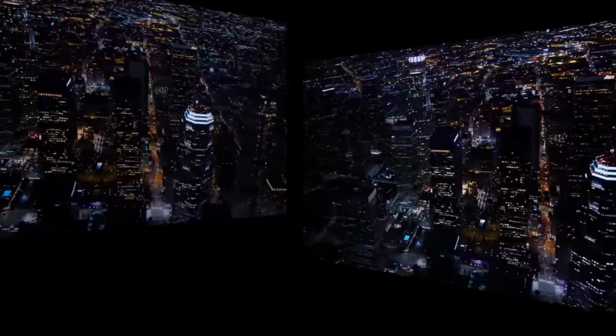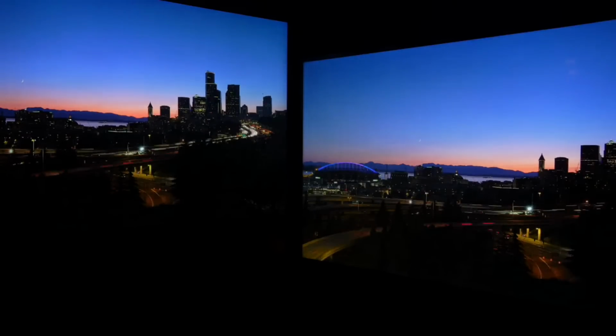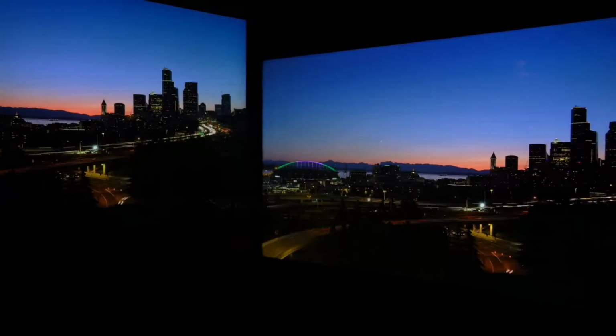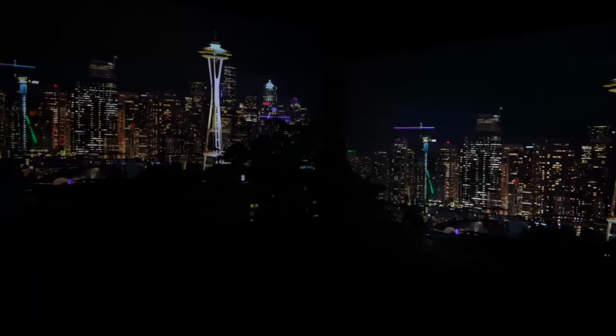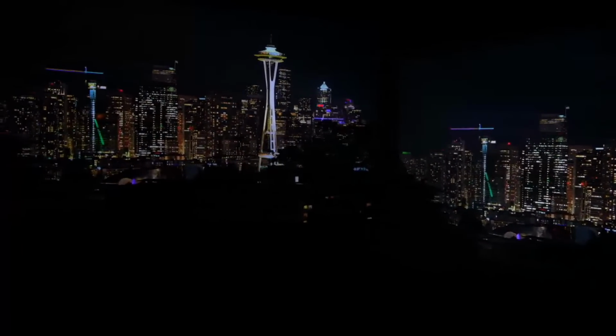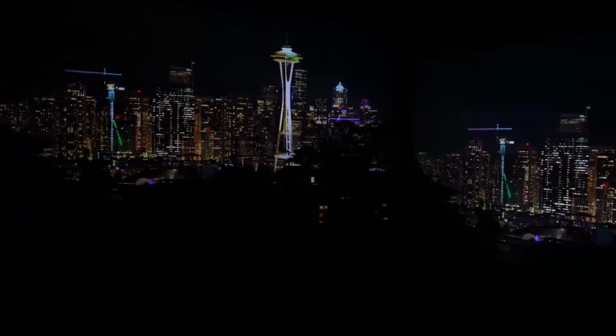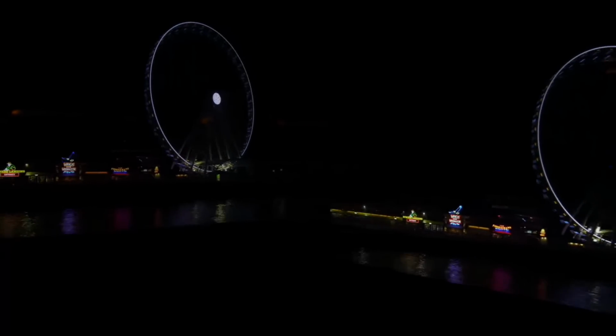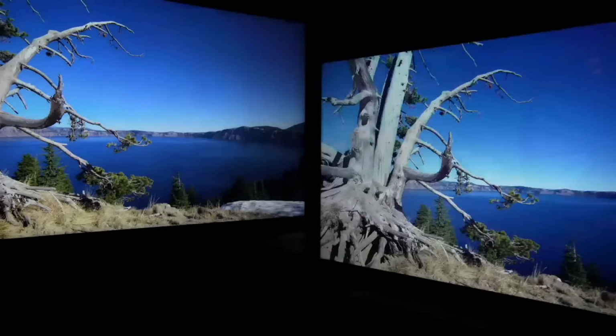Yeah, so on the Sony, you're looking at about 815 nits. On the Samsung, you're looking at around 1,550 nits. Now, that's with measuring only 10% of the actual screen size, so basically the center area. It's the standard of how you measure these things, but it's not going to give you the full picture.